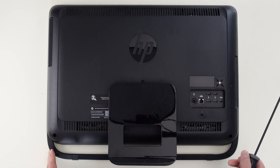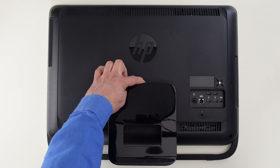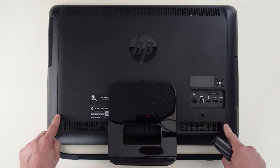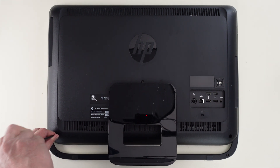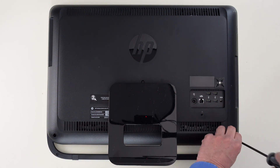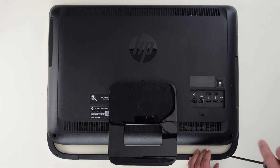To open up this all-in-one from HP, there are a total of five screws to remove. Every model is somewhat different, so it may vary for yours. This one has a screw here, here, here, one all the way down at the end on the handle on the bottom, and on the opposite side. These three are captured screws, so when we take them out they will not come out all the way. We may have to loosen them a second time as we remove further screws, because they seem to be somewhat dependent on each other in terms of leverage. These two bottom ones remove completely, so don't lose them.